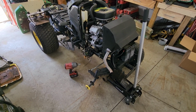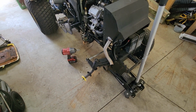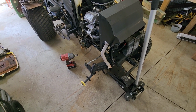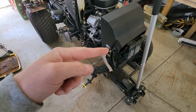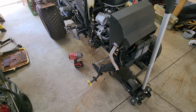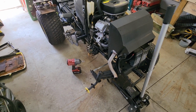So that's cool. The front wheel here had two different plugs in it, and it was leaking pretty bad from the one. It had a pretty decent sized hole in the tire that somebody took like two of those tire patch kits to try and fill, and it was still leaking pretty bad. I bought a different style tire repair kit on Amazon. It's got the little gun that it inserts the plug kit in, and it flares out once it's inside the tire. The hole is borderline just too big for it. I don't know what they ended up hitting with the tire, but that tire's getting a tube put in it right now, and I'll have that back here in a little while this afternoon, so I get it back on four wheels.